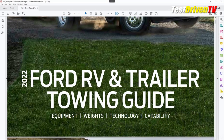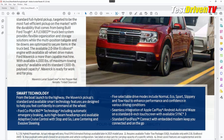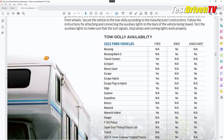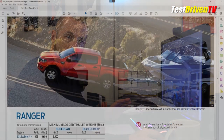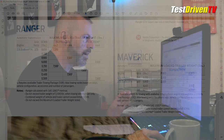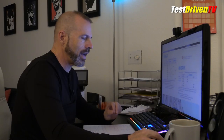When you have the PDF file open, you're going to find a lot of material. There's plenty of pages covering ratings for all Ford vehicles that you can tow with, plus explanation on how to properly outfit and use your vehicle when towing. Most importantly for the towing calculator, it has reference information you'll need when you go to put that information into the calculator. On page 37, you'll find the actual tables for both the hybrid and the EcoBoost with and without the 4K tow package, showing the GCWR — the gross combined weight rating.